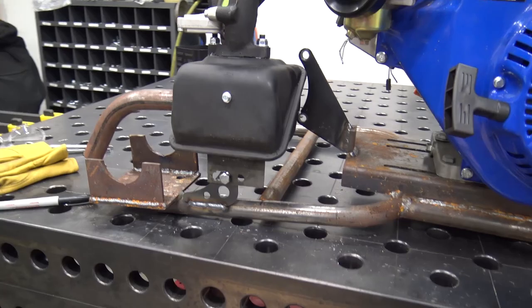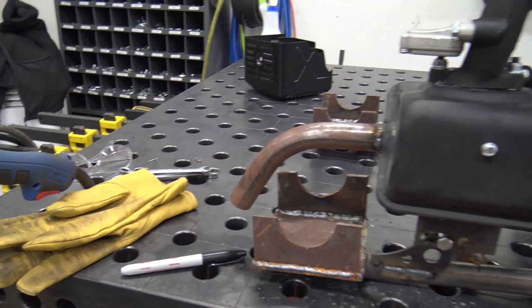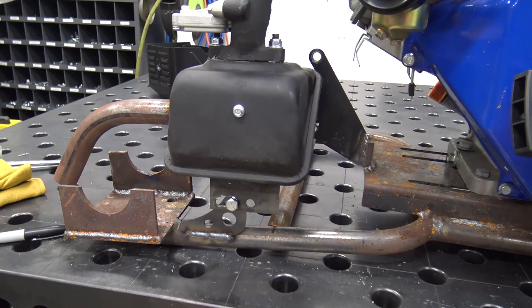So we got the engine and the whole swing arm assembly off. Now you can see how we have done this muffler. The turn down, of course, the axle goes through here, so the turn down goes over top of it. I need to weld the bottom side of this piece of tube going into this muffler, but I put a mount and I'm almost through.